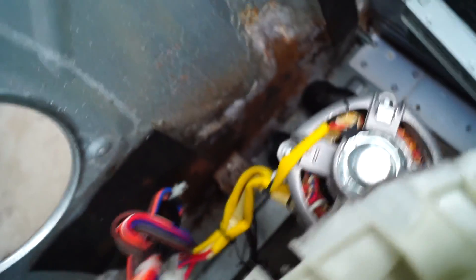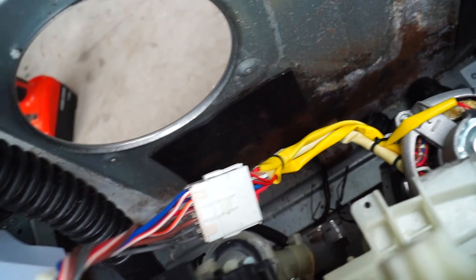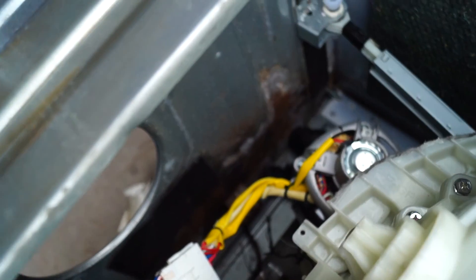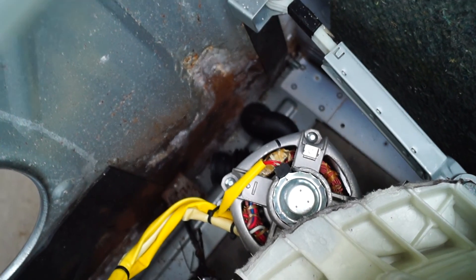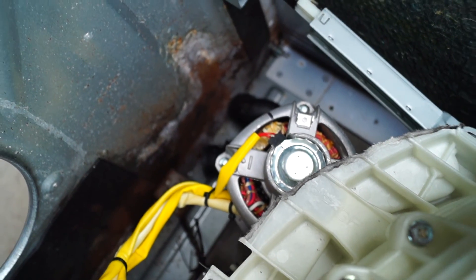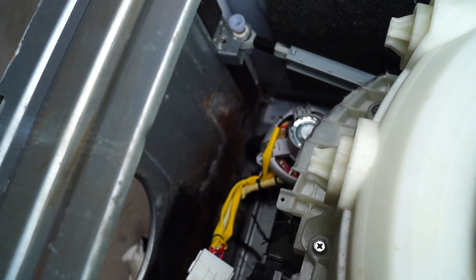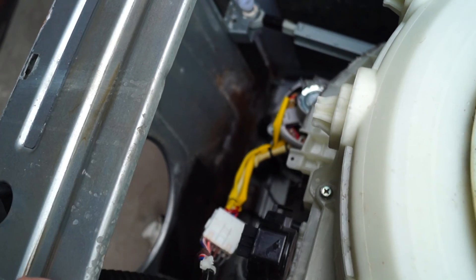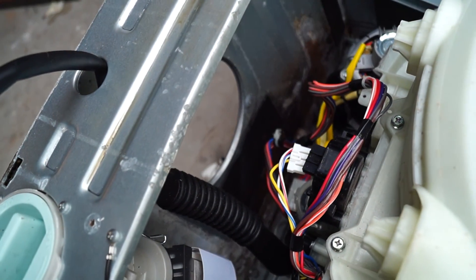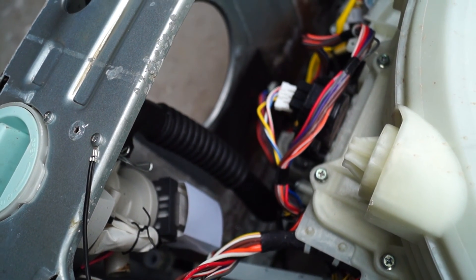Here's the motor and there's the motor cabling — a whole pile of wires going into that. If anyone can make sense of that, because that's beyond me. It looks like a universal brushed motor, but why would you use an inverter to run a brushed motor? You'd use an induction motor, surely. I'll continue stripping this thing down, try and get the motor out, make sense of it, and find out how to rewire this thing.